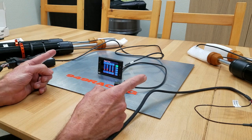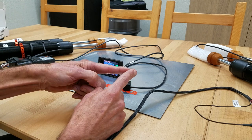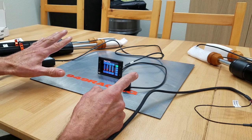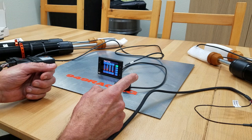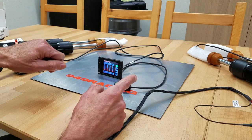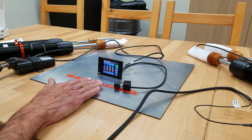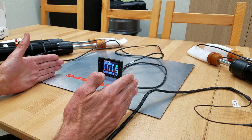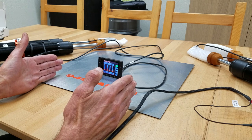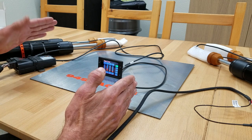With an Ace shock, it does the full range — it can go fully open with basically no damping at all, allowing the wheel to move very fast, all the way to full closed. When we say full closed: if you disconnect the battery, the shock will not move. You can droop the wheels down, drop the car on the ground, and the shocks stay fully extended for three days because they don't leak. The massive range goes from super incredibly stiff all the way down to fully open — like an old-school Cadillac — and it does this within six milliseconds, responding to data from the controller or onboard sensors.